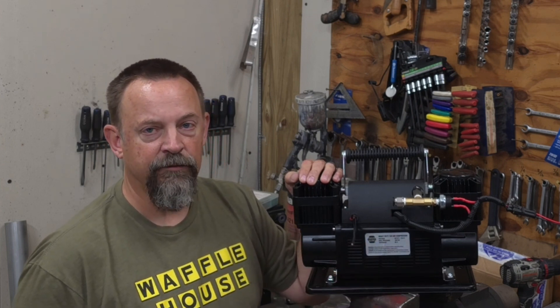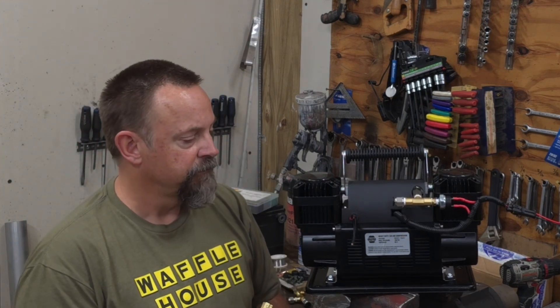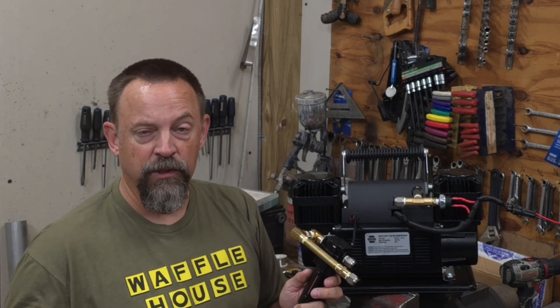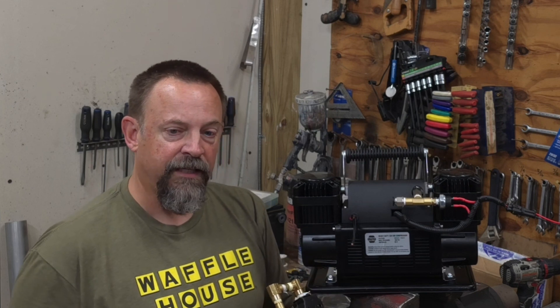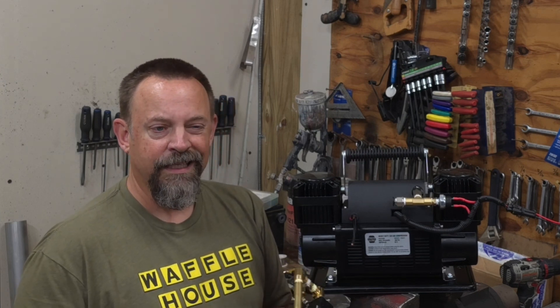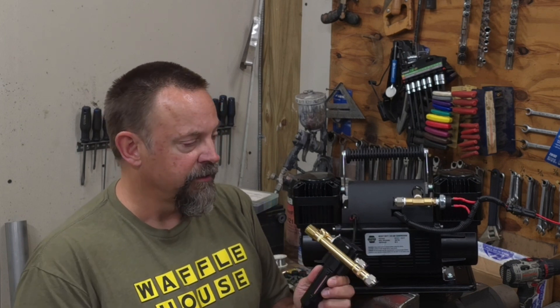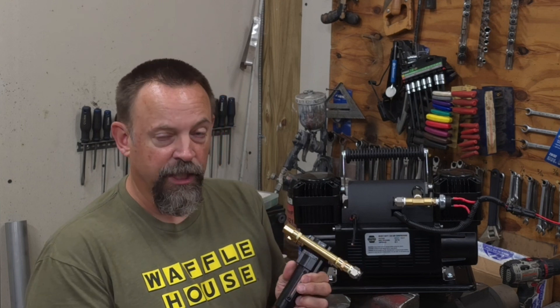I'm going to mount this to the side of the frame rail, and I'm also going one step further — I'm adding a water/oil separator. Most people don't do this for onboard air systems for airbags, but I already have a separator on my York setup to keep oil out of my air tanks and airbags, and I'll do the same on this setup. I found the York produces a lot of water in the separator as well, and I don't want that in my air tanks or airbags. For 30 bucks you can get another separator, so I'll mount it underneath the rear fender where I can access it to drain it.